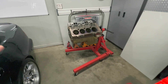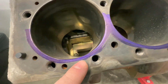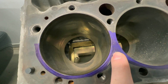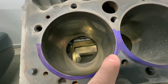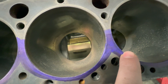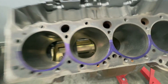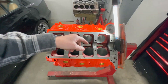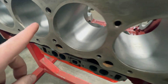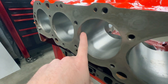You do that on both sides of the chamber on all eight cylinders, then pull the head back off. I've already done that here on this 327 block, and it's not as much — you can see it right here. It looks not as bad as it really is because of the chamfer on the cylinder, but it's maybe an eighth of an inch here. You can see where I've scribed it — just a little bit of cleanup needed and I don't have to be nearly as aggressive. But it's quite dramatic on these big blocks — you can see I've really taken a lot out.